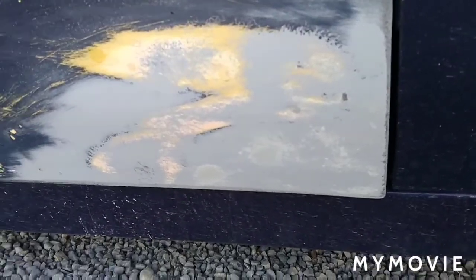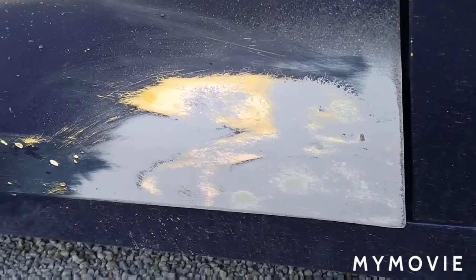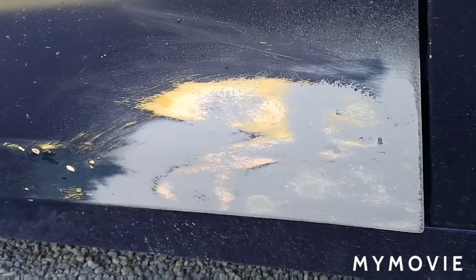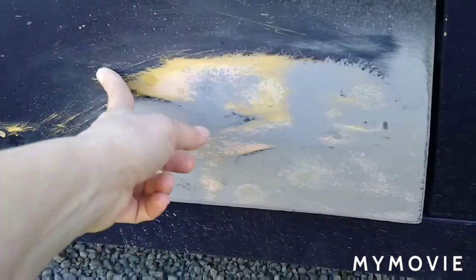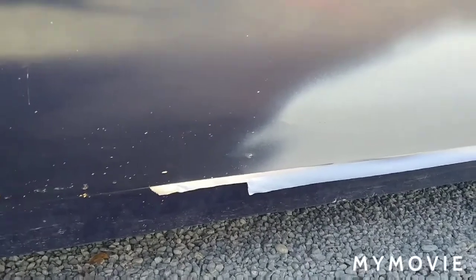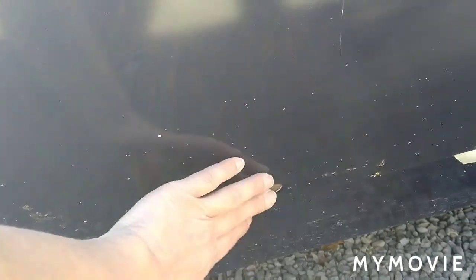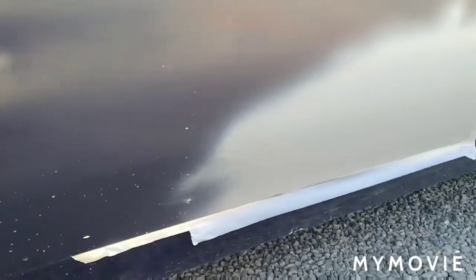So I'm just going to prep it and put a little bit of can primer back on it, and then hopefully paint it over the top and not have any issues. But never guaranteed when you've got open edges like this. So these are some of the issues - I just blew off a whole chunk of bog underneath, with rust underneath, when I was just blowing down to kind of dry that so I could do a bit of painting.